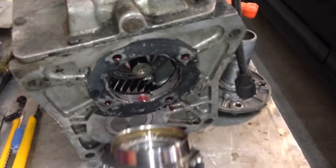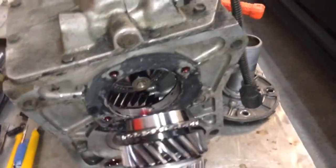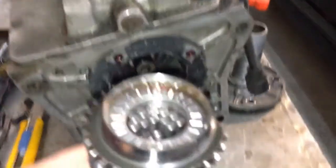But the most important part — you just take off the bearing right here from the front. I've already removed this one here. What you want to do is tilt the tranny forward, take the four bolts off, take that bearing retainer off, and tug on this here — just get it in the right place, tug it out, get it out.